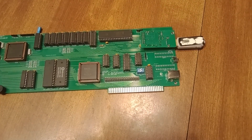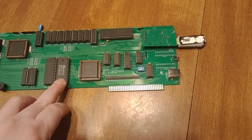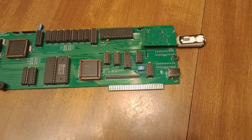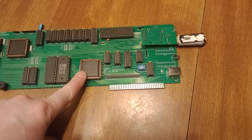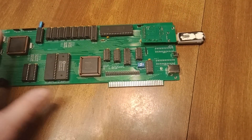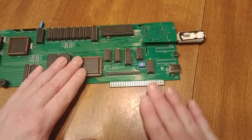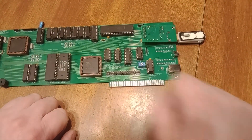It basically boots up. I've reprogrammed the BIOS — it was kind of getting hung up looking for the ready command on the CGA card and just sitting there waiting, so I took that out of the BIOS. It sort of thinks it's got a CGA card installed, and it reads and writes to the video memory. Then your second computer can come in and read from this side and display it.